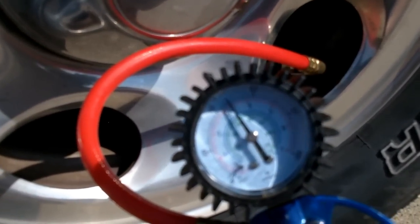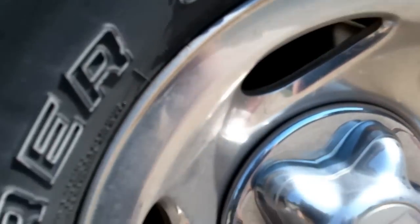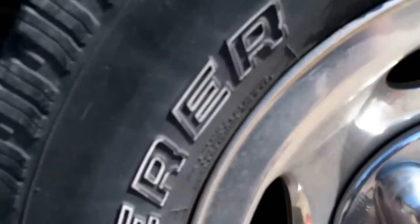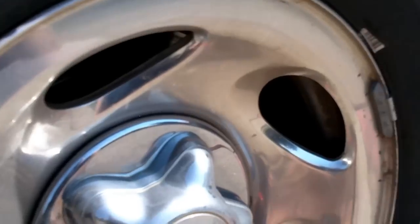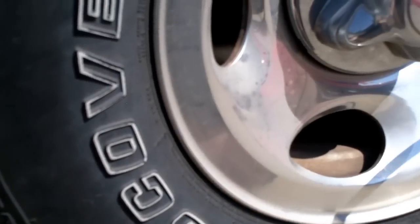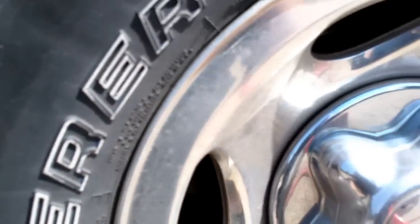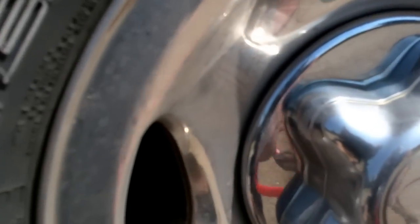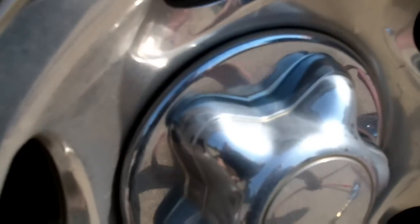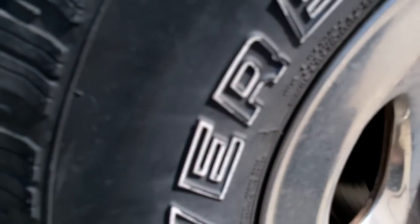Always inflate your tires to the recommended specs. When you go aftermarket with your tires, sometimes — for instance, these are six-ply tires; when you buy the truck new it comes with four-ply. These are Cooper Discoverer STs. If I put 32 pounds of air in these six-ply tires they look freaking flat. The tire says max inflation is about 65, so I'm going to go 45 and leave it at that. I haul heavier loads with this truck so I went with the six-ply tires. If y'all have any questions, let me know.